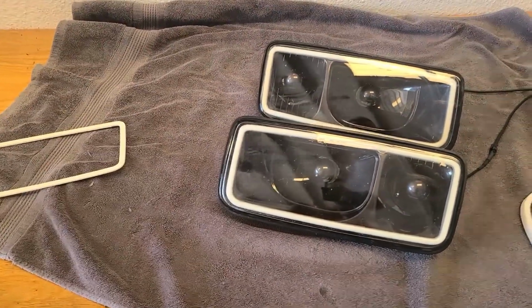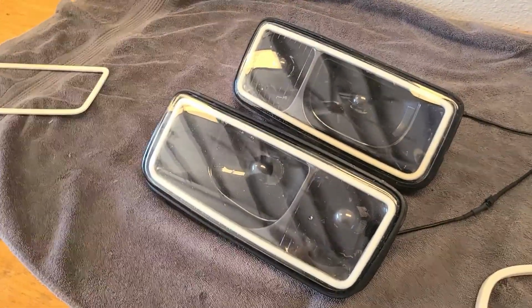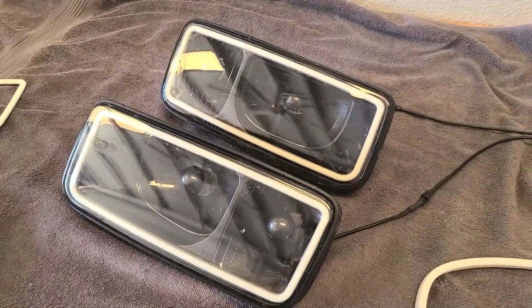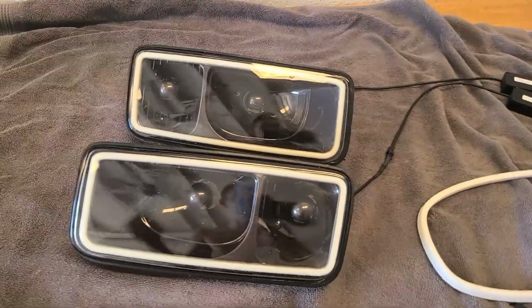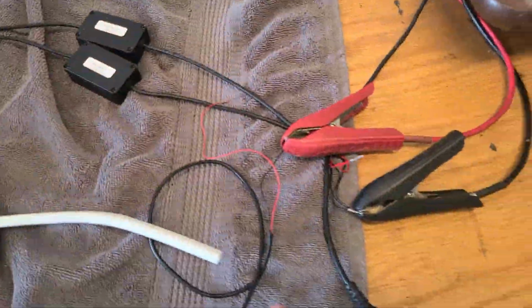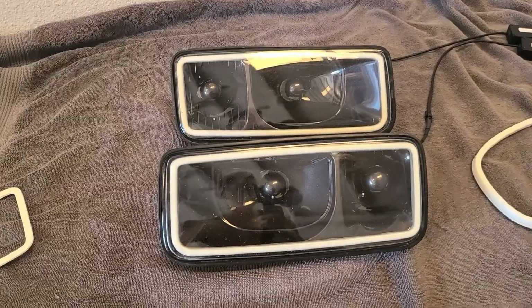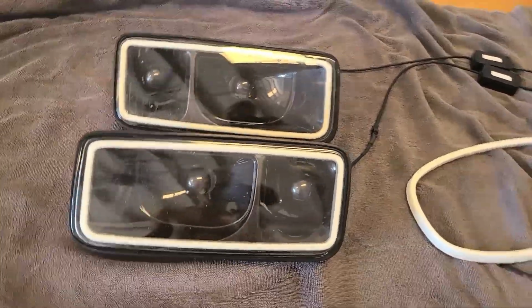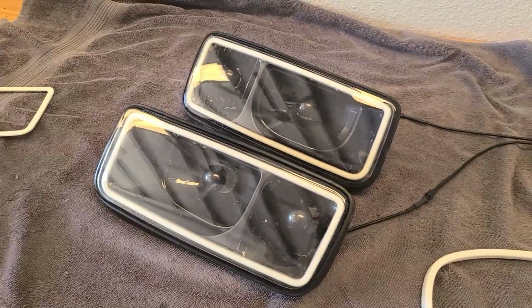And with that AutoCAD file, we sent it off to the custom halo manufacturers overseas, and they created these halos specifically to spec. Now the client's request was very clear in the fact that he wanted a 2-wire hookup. So through these drivers we literally just have a positive and a negative, so that limits us to a single color. So this is a white only halo. It would have been really cool to do a switchback, but that would have been 3-wire, and apparently the client was not up to that installation challenge.